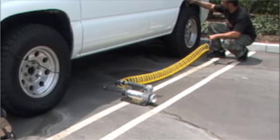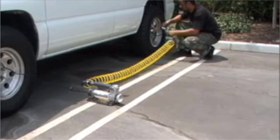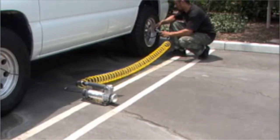If you attempt to fill a tire and the unit will not power on when squeezing the inflation gun trigger, bleed off a few PSI of pressure from the tire to allow the built-in pressure switch to power on the unit.